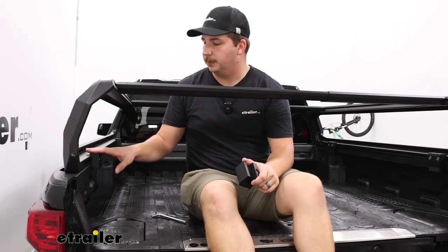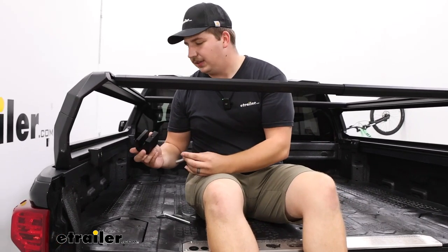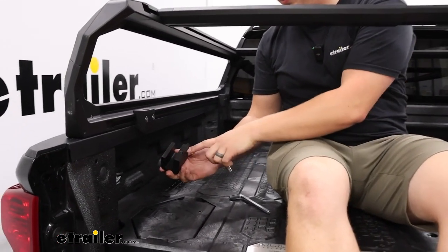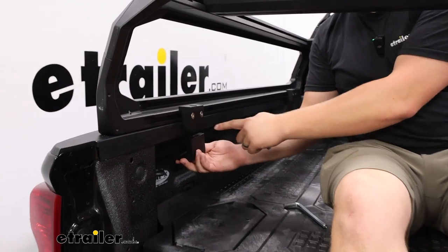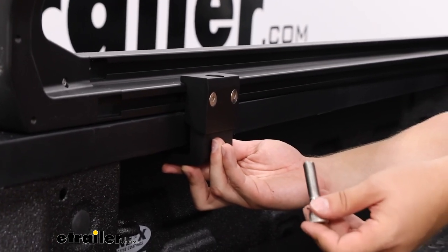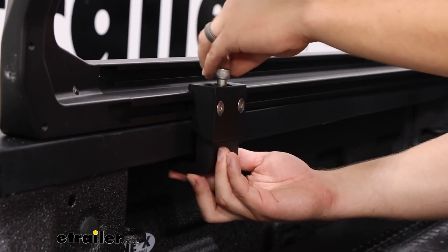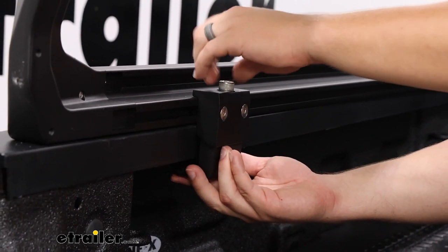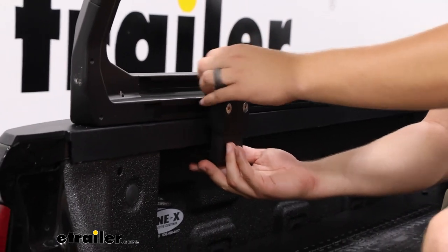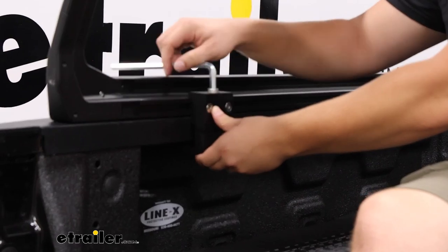When you've got your base into the proper position where your clamp's not going to interfere with anything, slide the clamp up into place with the threaded hole slotting into that base. Take the largest hardware with a flat washer in your kit, drop it down through. You can thread it in by hand to make sure it catches. And then use the corresponding Allen key to tighten it the rest of the way for all four clamp locations.